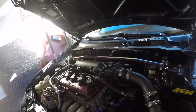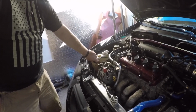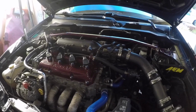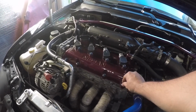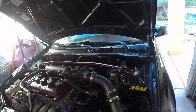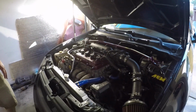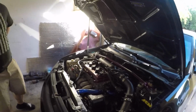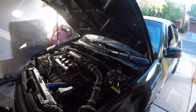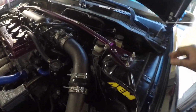Alright, well, we're gonna set this down, we'll get cracking. You know what's funny? I filled up this reservoir 2 months ago. Come down a little bit. It's like QR life. Shit with the badass bolts here. Titanium Johnnies. Well, let's jack this bitch up, and you want to take the wheels off? May have to. At least this one, just to disconnect it from the column. Okay. From the rack. But this one we can stay on. It's easier to judge the toe with the wheels on.